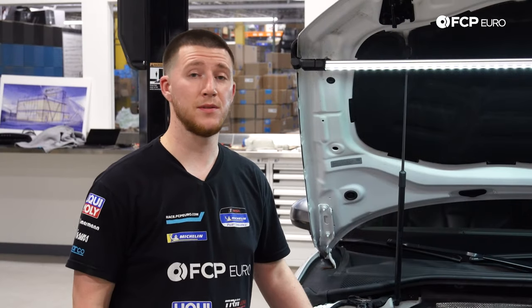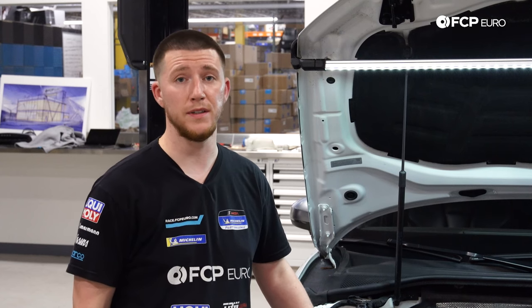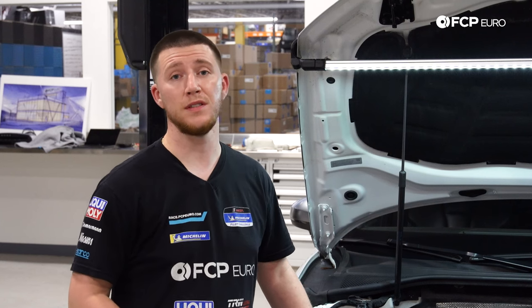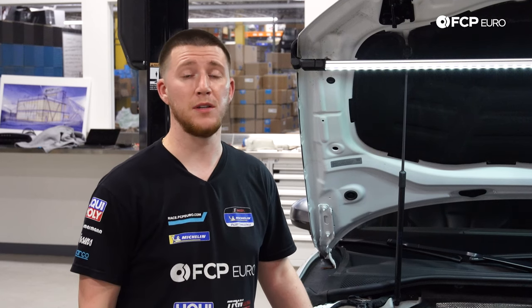That's how you replace your water pump and thermostat on the Audi S3. This is also applicable to the Audi A3, TT, or TTS with the 1.8 or 2.0 liter turbocharged engine. A quick tip: when installing the water pump, I found it works better to slide the water pump belt on the pulley itself first and then plug in the union — it allows the alignment for the water pump to go on the block a lot smoother. If you liked the video, don't forget to like and hit the subscribe button. Leave any questions in the comments below — thank you for watching.